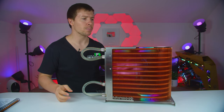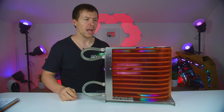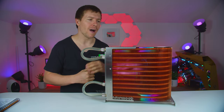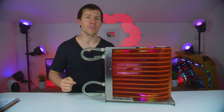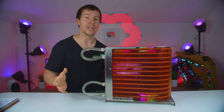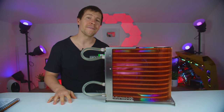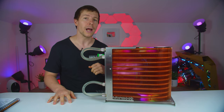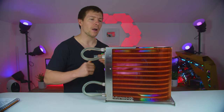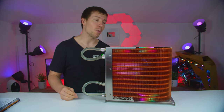And also one last thing I'd like to point out is being the quietest small form factor case, it's a very hard thing to determine because that all depends on the type of hardware that you use. For instance, I have a D5 pump in here without any reservoir, so if there is even a tiny bit of air that gets stuck in there, that sound is going to be noticed. Now, it also depends on how fast your fans are running. For instance, these fans right now are on 1500 RPM. I could turn them all the way up and it would cool the build a lot more. But at the end of the day, we're trying to mimic the situation that the company is trying to create, which is a quiet performing small form factor case.